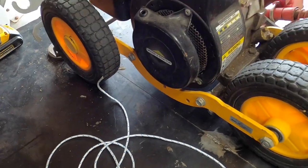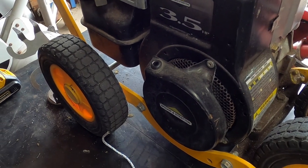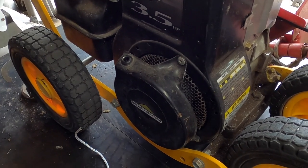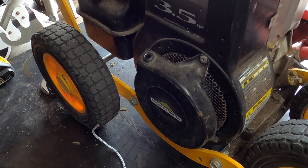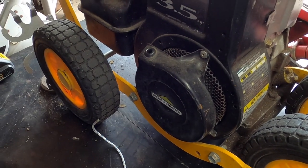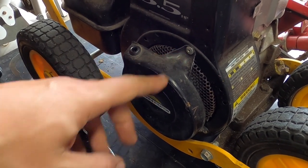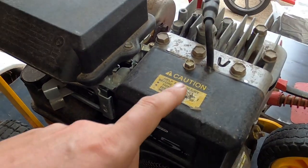You don't want fraying to happen because then nothing good occurs. Now the person who brought this to me thought you had to drill these and re-rivet them — no, you don't need to. You should not put bolts in there, because what's going to happen is you'll put a bolt from the back, the flywheel is very close to this tin, and if it hits it you won't be able to run. You'd end up with a length of unused bolt just sitting in there. Don't do that. We don't have to re-rivet anything.